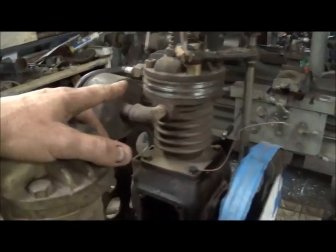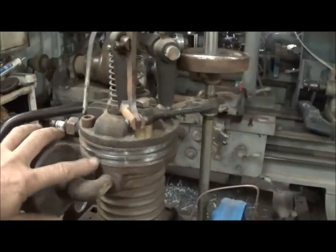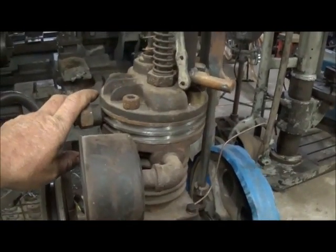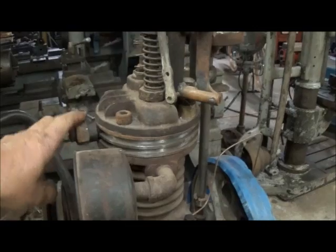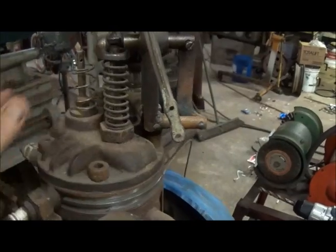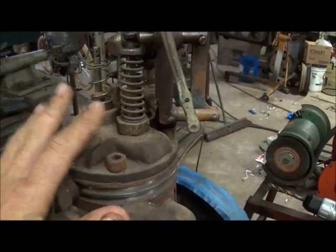So what I'm going to do is tear this one down and build it on video from start to finish. The combustion chamber I may have to make smaller. This is the combustion chamber I made because I wanted a 7/8 spark plug - the big spark plug. But I'm probably going to have to go with either the 18 or 14 millimeter, which is the smaller plug. The valves are so wide in there that it's actually bigger than the cylinder, so your combustion chamber has got to be clearanced inside. I'll show you all that.